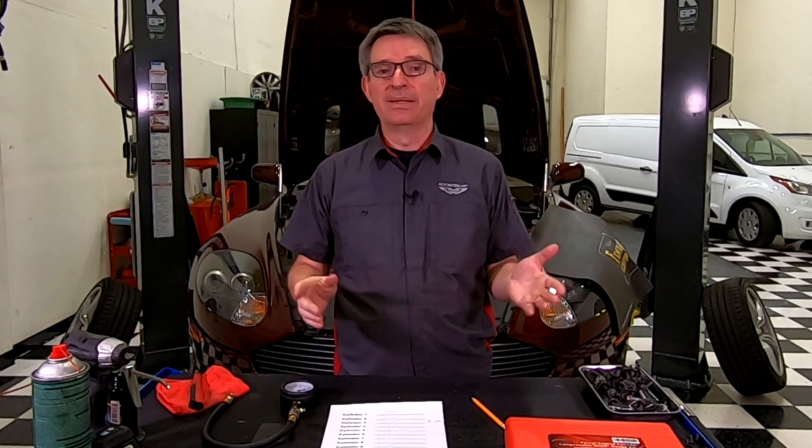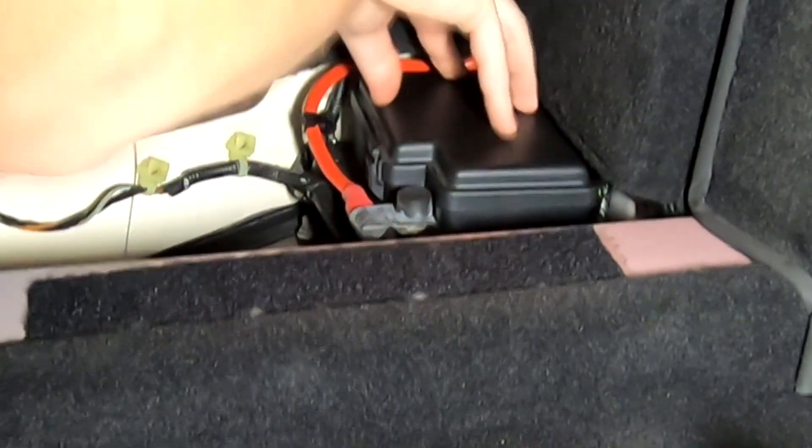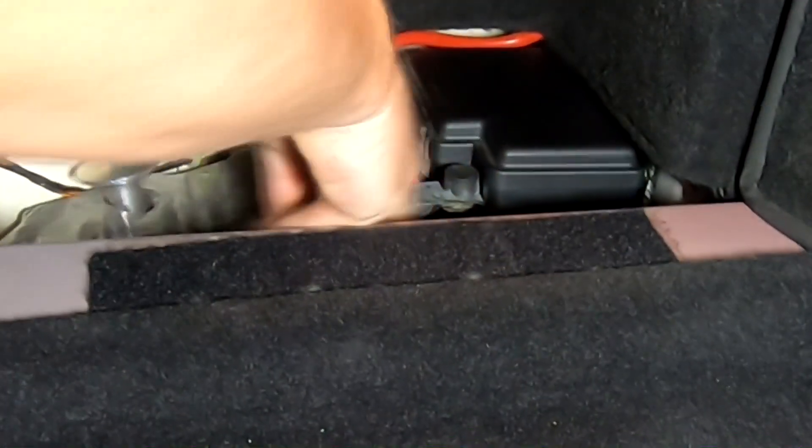With the testing done, a couple of things to remember: take your key out of the ignition, disconnect your battery again to finish the rest of your plug and coil pack work, go put the fuel pump relays back in, put your cover back on, put your toolkit back in, and put your carpet back in the trunk.